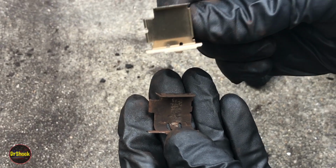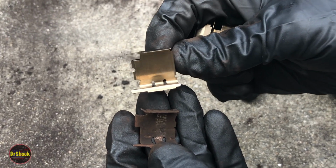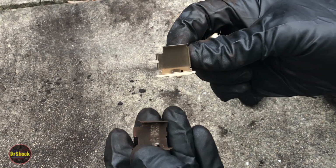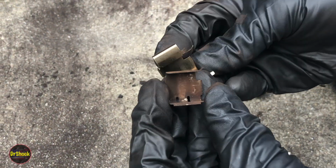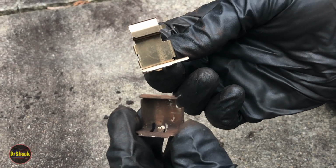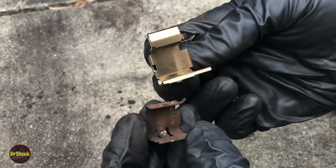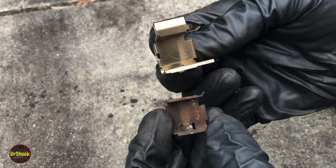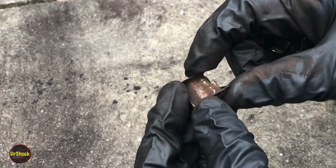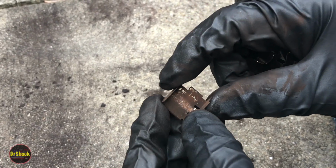So these won't fit in a 14-inch torque plate, and these won't fit in a 15-inch torque plate. 14-inch, 15-inch. But the outboard ones are noticeably different, right? It's like this. This is a 15-inch, this is a 14-inch. Anyway, so hopefully that helps you pick those out. I'll put all these part numbers in the description, and I'll show you the orientation of how these go in, at least on the 14-inch, which is the vehicle we're working on here, which is a 2000 Toyota CE.